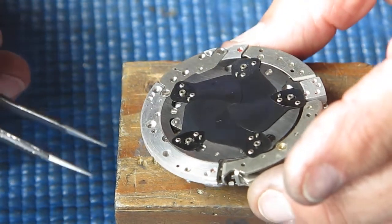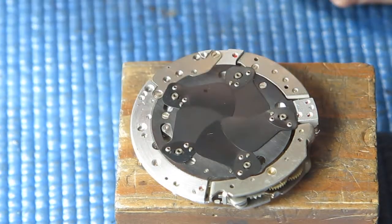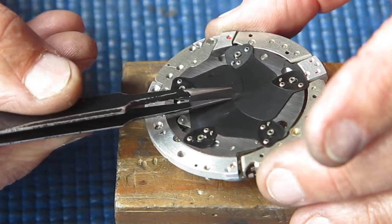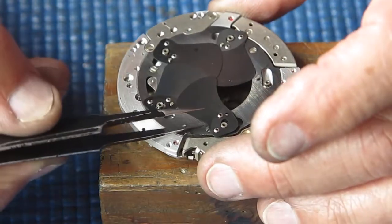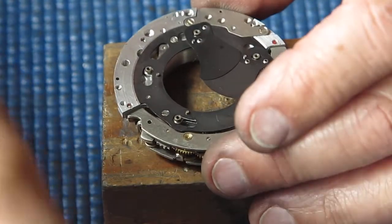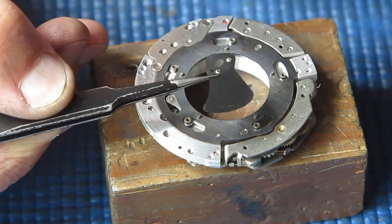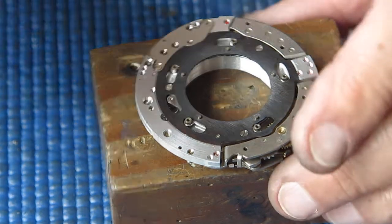I'm taking note of where the first blade is fitted — it's over here near this thin piece of the aluminium section. You can see that's the first blade, second blade, third blade, fourth blade, fifth blade. I'm looking at the state of the blades. The very tip of this blade is bent — it's bent up, so that it slides easily over the blades below it presumably. I'll lift off blade five, keeping these in order: blade four, blade three, blade two, and blade one. Blade one is interesting too — the tip on that is bent the other way, it's bent down. Take note of that.